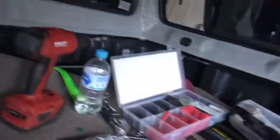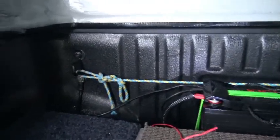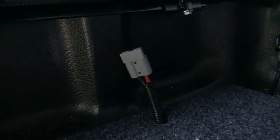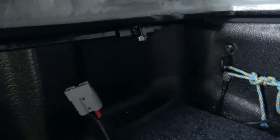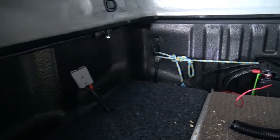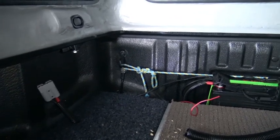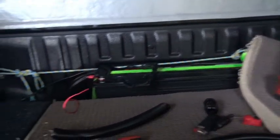A bit of a disaster zone here with all the gear, but that's all wired in. I tested it out and it's working. That's the unregulated solar that runs into the DC-DC charger - I'll tidy that up and mount it there somewhere, just wanted to get the Anderson plug on there. Pretty happy so far. Still got to wire in all the accessory points and all that, so that's for another day. This has been a bit of a mission trying to get all the cabling through everywhere and through grommets.